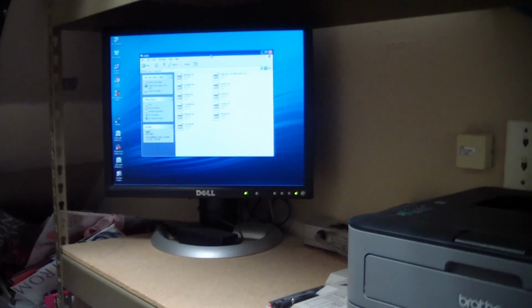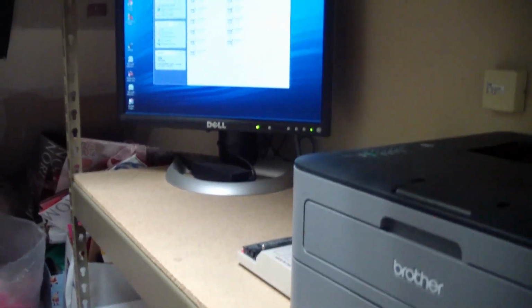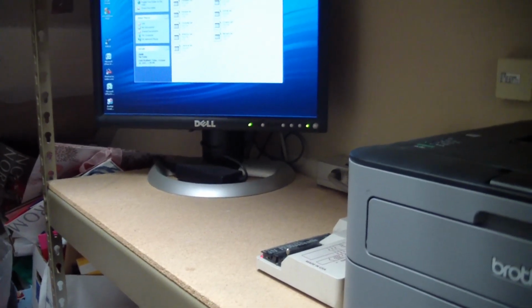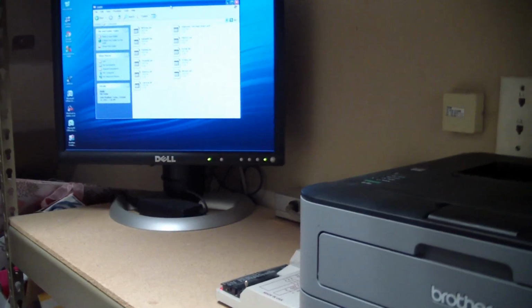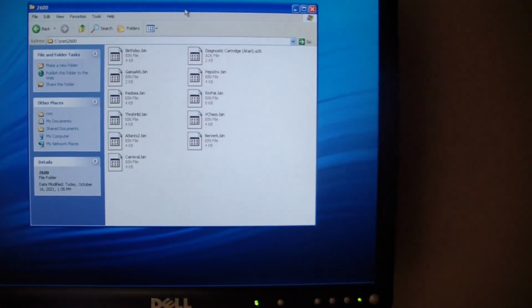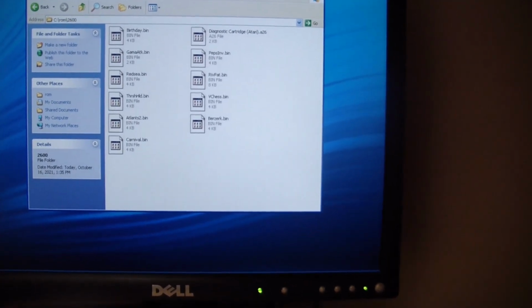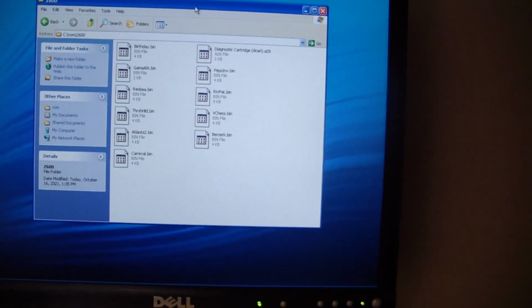So let's actually go through the Eprom burning process utilizing my state-of-the-art Eprom programming hardware. Everybody has a different Eprom programmer, of the vintage type, and they all have different software. This one's requiring WinXP, and here's a list of ROM images that I downloaded. Carnival or Berserk. There's also this chess program, video chess, but it is rumored that if you put it on the hardest level, it takes like 10 hours for it to make a move. So that wouldn't be too much fun to test, so I say let's do Carnival.